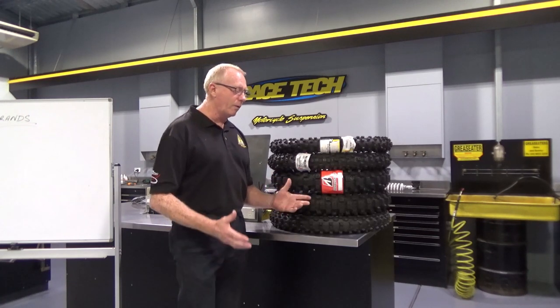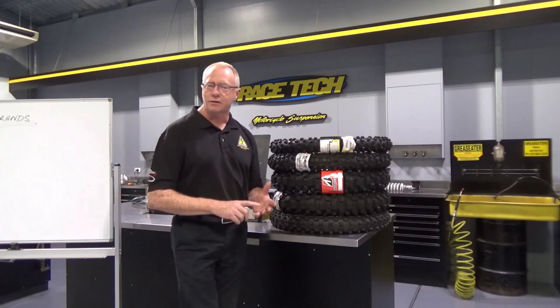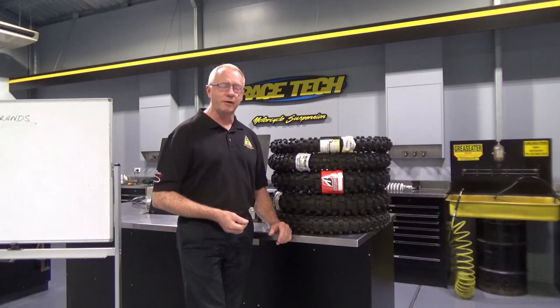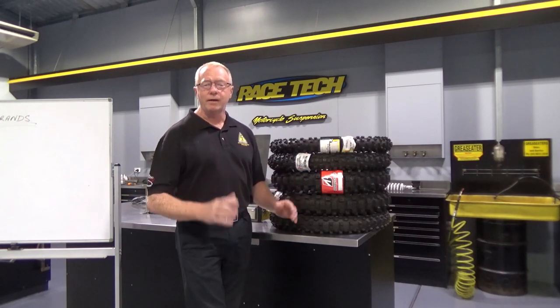Just keep that in mind and be very mindful of having the right tyre for the right situation. When we were racing in the Nationals, we had a pile of tyres you couldn't jump over — mud tyres, sand tyres, soft tyres, intermediates, hards. We could actually change our tyre to suit the changing conditions of the track. If we went out in the morning and the track had been well groomed with a lot of water, we might go out in first practice with a mud tyre. Then as the track developed and more riders had gone over it, we'd change to the soft, then intermediate, hard, or whatever, depending on the conditions — getting the ultimate result for every outing.